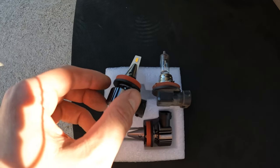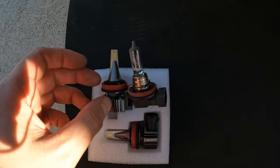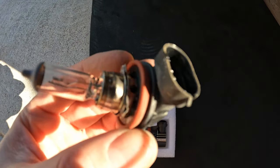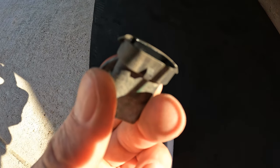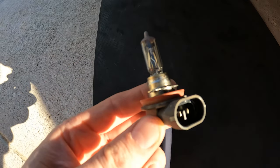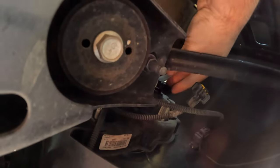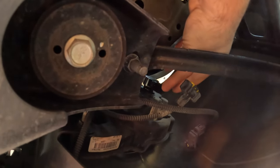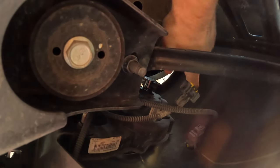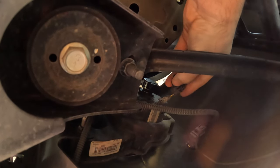When you unplug the wiring harness, you have to pull the tab upward — don't push it in, pull it upward. It unclips from the little nub and then you can pull the bulb right out. I had plenty of room once the camera was down — everything came out pretty simple. Make sure your connectors aren't corroded on the harness; you can use some electrical cleaner if needed. With the new bulb in place, on the passenger side you'll want the connector off to the side, slot it in a little bit, then lock it by turning clockwise — the connector should face downward and the harness should snap right into place.